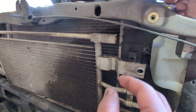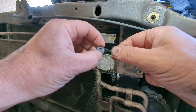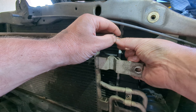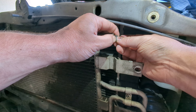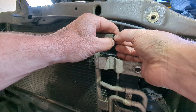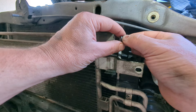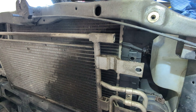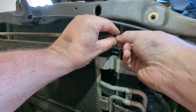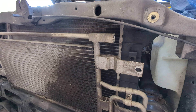Basically what you're going to find when you get your cooling stack apart and you get down to your transmission cooler is this plastic plug is going to be in here held in by this little ring clamp. You need to get that out, and then the tricky part is getting this out because it's going to have an o-ring around it that will make it hard to pull out. I actually ended up using a glue pull dent kit, glued onto there with hot glue, and then was able to coax it out of that hole. That's probably the hardest part about this mod.